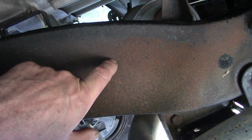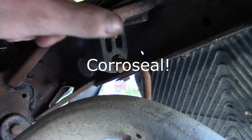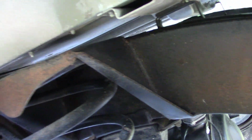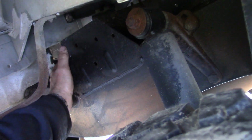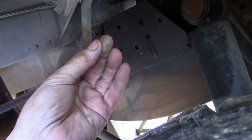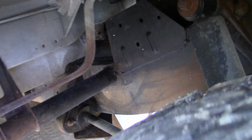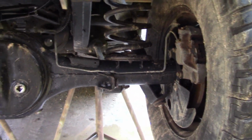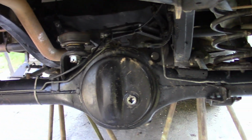We're going to treat it with Corrostop, same with all these brackets here, but I want it dry, the humidity out of it, because then I'll blow it around with the air gun to make sure there's no mud in these little sockets here. There's a little bit up there, look, but you can see it's still wet. So when it dries out, we'll have a go. But you can see how it's dried out with the mud here. So we'll just blow that off with an airline, and then we'll apply.